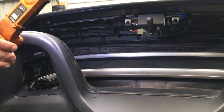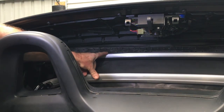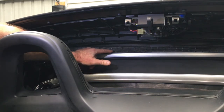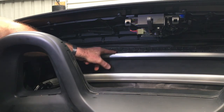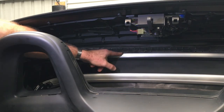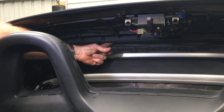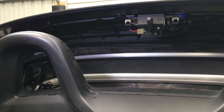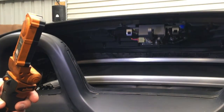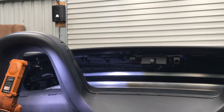So you can see everything's collapsing at the back here, and you'll probably notice that where the original holes are, where the original pleat was, it's starting to come down and gets very close and pulls pretty much on the edge. So even though there was a lot of tension on it, it was pulling on the bit that was hard up against that bow, instead of being in between the aluminium piece. And so you can see I've shifted that, so now it pulls in much more effectively in between that gap, so it pulls it nice and clear at the back. It might be a bit hard to see what's going on there, but it's pulling it in nicely.